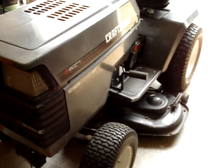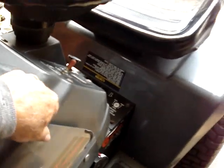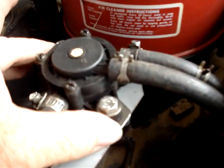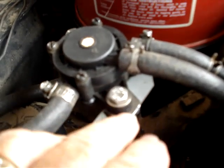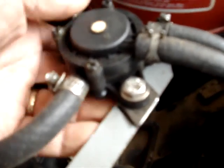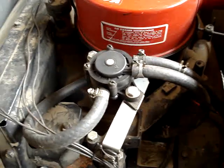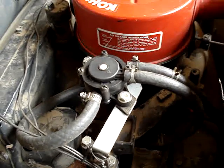Here's the follow-up. I've mowed the lawn twice with this tractor — about two acres each time — and it's performed very well, just as it did with the original fuel pump. I did make a little metal bracket here that just bolts through the existing bracket, with another piece of metal that bolts the fuel pump down. I'll put a little insulator pad underneath, just like a gasket material, to act as a heat sink and stop heat from soaking into the bottom of the fuel pump. Works real good — happy with the turnout. The vacuum pulse pump is the cheap alternative to buying mechanical fuel pumps for these.